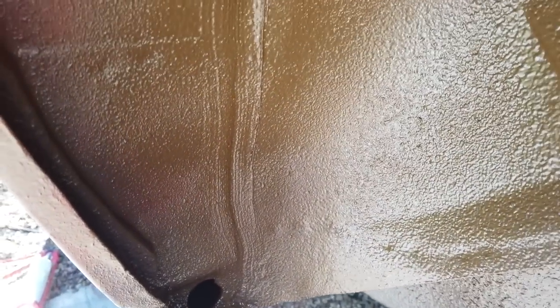And into the back tub. So there's that seam we just put on. You can see, just indistinguishable from factory, I would have said. See how you get that? And then down there where the bung will go, that's for spraying the wax oil, spray liberally into the sill.